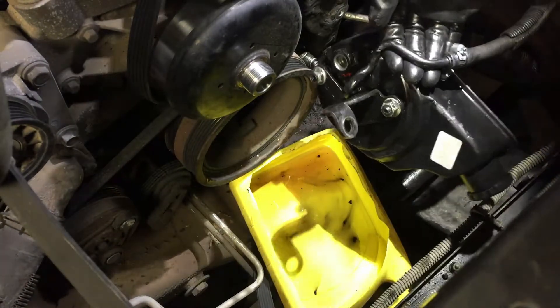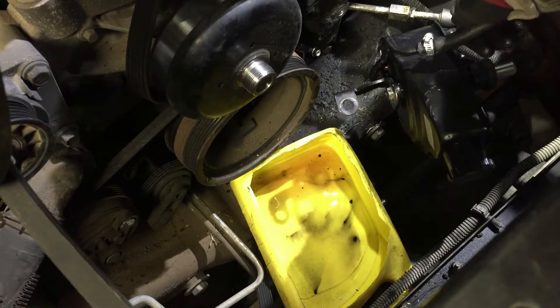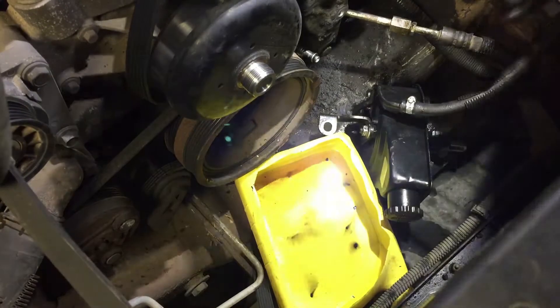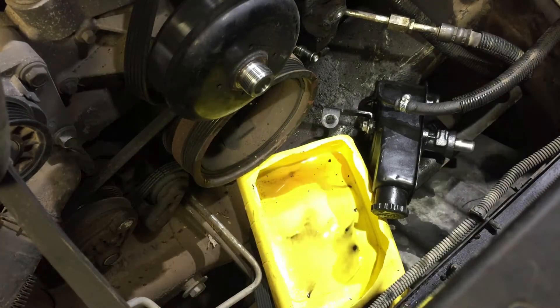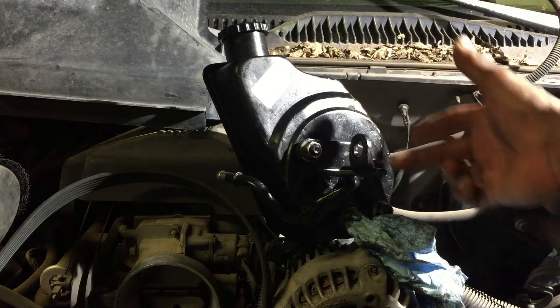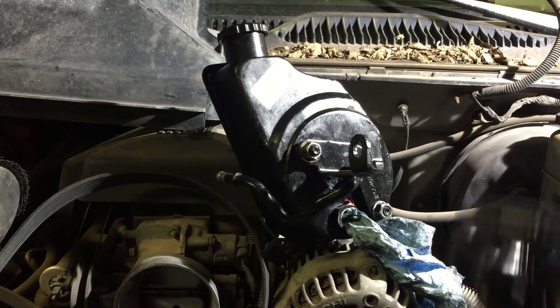This other hose has a clamp — I went ahead and broke it off, it was a piece of crap, so I'm going with a quarter-inch socket instead. Loosen this, then the clamp is stuck on the hose so I just destroyed it and I'm going with a new style clamp. There's your pump. Take off this bolt and this bolt, remove this bracket, and put it on your new pump. The reason I'm doing this over again is the old one was leaking from this connection right here. When I put the new pump in, the damn thing still leaked.